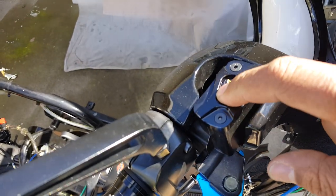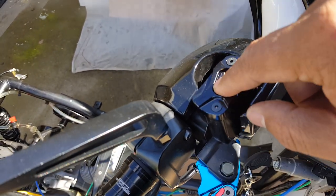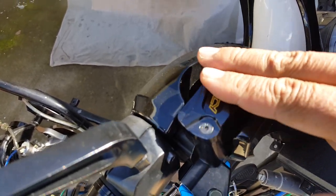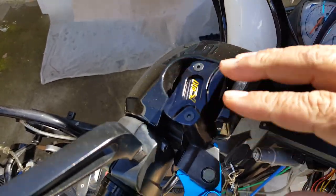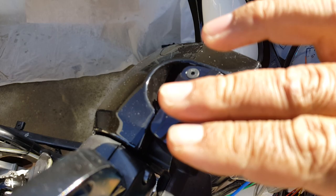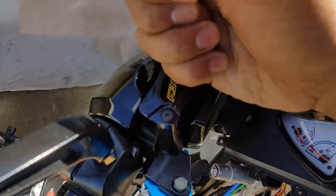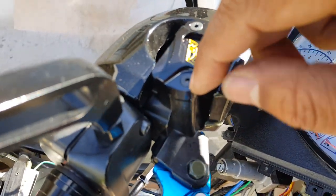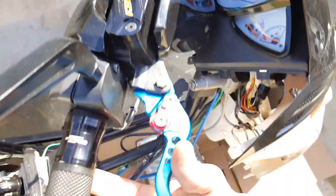Be careful — you don't want to put your vacuum to suck all your brake bleeder out. Put at least a rubber cap first, then put the plastic cap. The plastic cap has that little small hole so it can still suck almost everything out of your brake bleeder. The rubber one doesn't have any hole, so my trick is: take out the aluminum cap, put the rubber one, then the plastic cap over it sealed, then go ahead and vacuum everything out — especially if brake fluid dripped into your allen bolt slots.